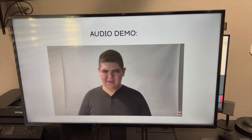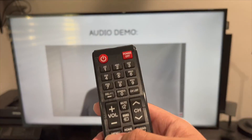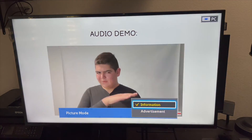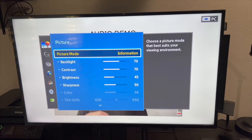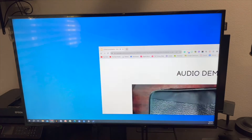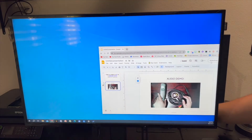For audio with VGA, you again need to pass a 3.5mm cable to audio-in on the display. You can go to Menu and switch the picture settings — Advertisement or Information. You can see the difference; it does make a difference in brightness. I'll keep it on Information. So that's VGA — similar to DVI. Let's unplug the VGA connection.